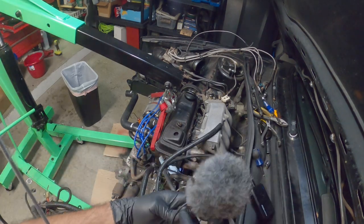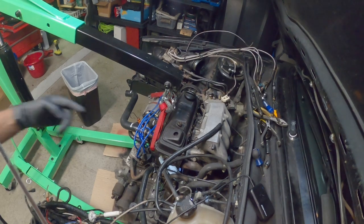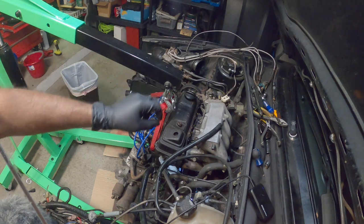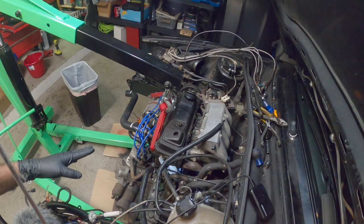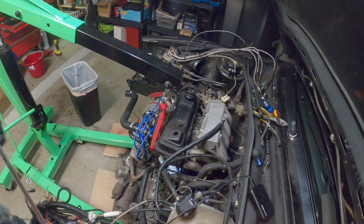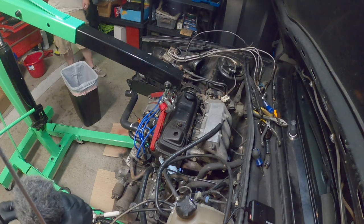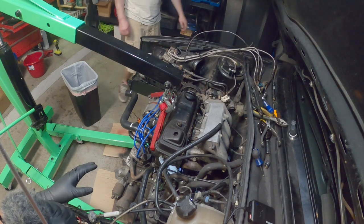All right, so pretty much we got the right motor mount unbolted, which is 17 millimeter. The three left motor mount bolts removed, 13 millimeter. Axles removed, done. He has Allen bolts for axles, so they were 6 millimeter, right? That's what he had on here. But if he had a Torx, it was a 40 mil. No, yeah, T40. So everything is now completely unbolted. Everything is ready to go.